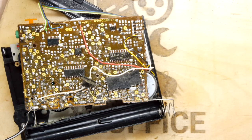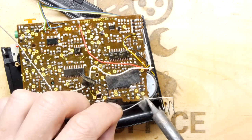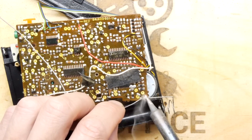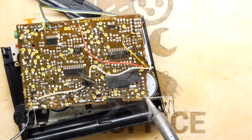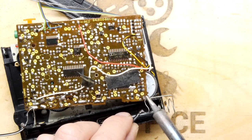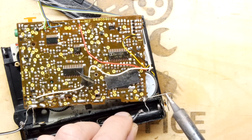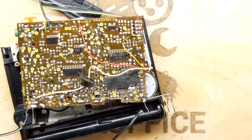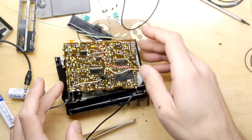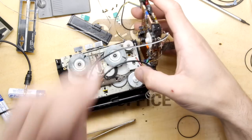That's my gut feeling, because although I did the trick of applying a little bit more voltage to the motor, when I changed different tapes, they all had a different pitch going on. So it's probably down to whether or not you've got one of those long play audio tapes versus one of the ones, you know, kiddie single. And then the problem with that is that it's always going to be wrong, basically. You're relying on the wrong kind of force to get that going.